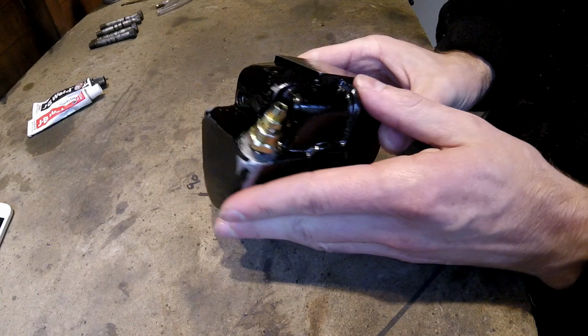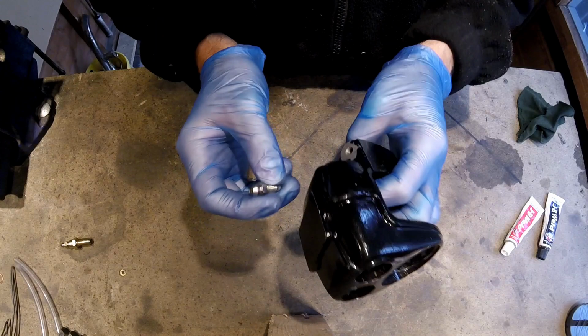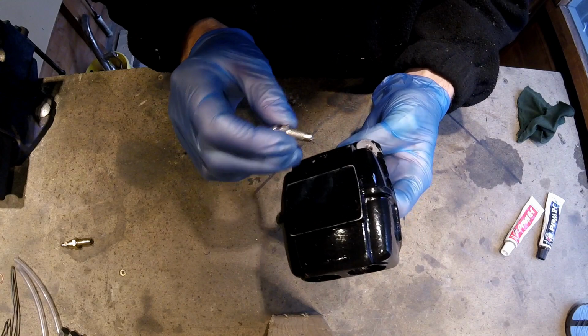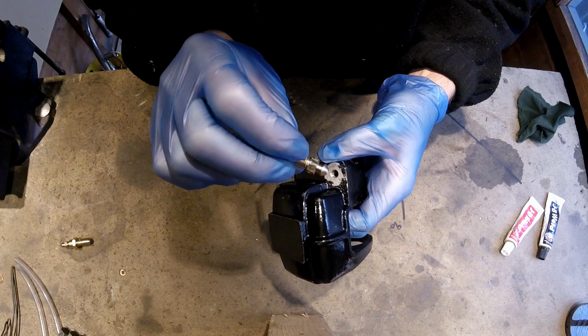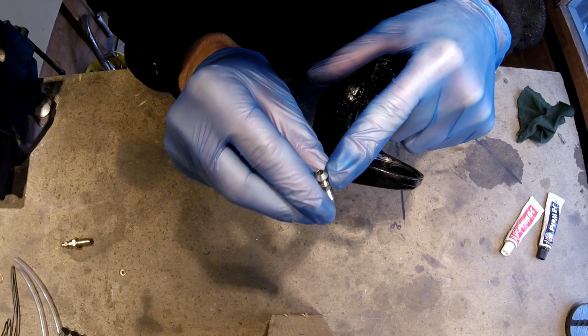So that's my thought process. The first thing I've got to do, or have done, is to rough up the surfaces where these parts are going to be sealed. So I've run some sandpaper down here and round the brake nipple. I don't have a bolt that's going to fit, so I'm going to have to use this. I've also run a drill bit down the end, just to score up the inside of the bore on that, because I'm going to have to fill it with quick metal.